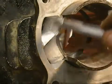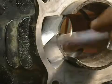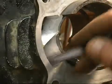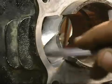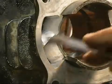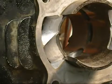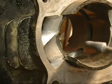I spent about an hour on the transfers — covered everything I could get to safely from this spot. As far as what you're going to do here: get in as far as you can and stop right there, just cleaning off casting flaws. Same process as with the exhaust port. What we're going to do next is blue stone, and that's going to be it.